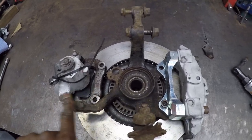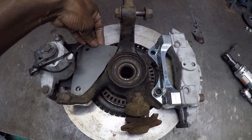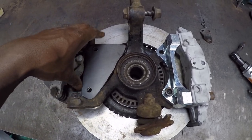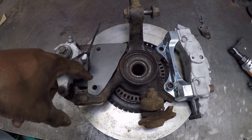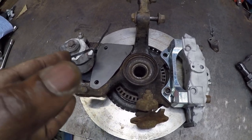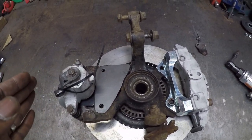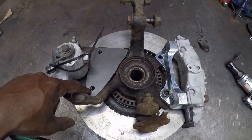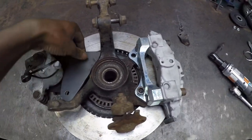The plan originally was to have the two calipers facing each other with a set mount just here. The problem is that the bolt hole on the caliper is quite close to where the track rod end sits. Although this is a front hub going on the rear, it won't be going left and right, but it will be going up and down, and the ball joint will pivot through suspension travel - it'd be too close to that bolt, possibly touching. So that idea went in the bin.